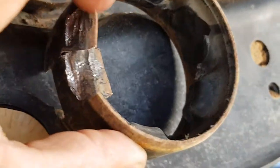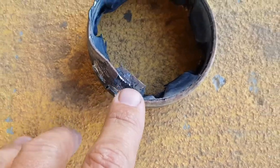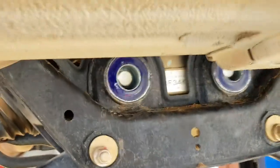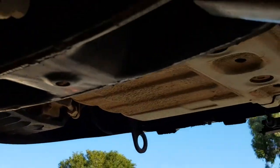It's an air hacksaw and we put that slit in it in two places — front and back — because you can get access pretty easy in through there with the hacksaw, and then you get in the back here. Access isn't too bad. See up in there. And then you just whack it with the chisel and knock it out.